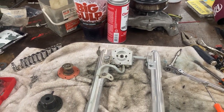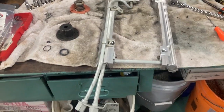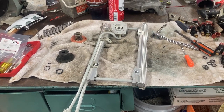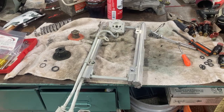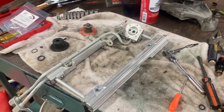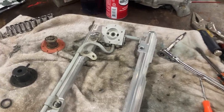On a stock TPI car, the injectors are 22-pound injectors. I can't reiterate enough — if you've got the original ones in your car, get them out while you've got everything apart. Especially if they're the gray Multecs, get them out. Put something new in there; they're available at auto parts stores and South Bay Fuel Injection, among other sources.